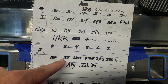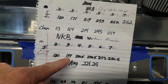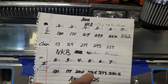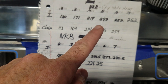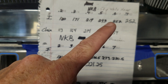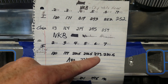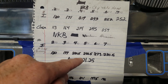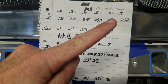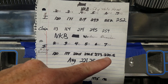Already down here on the intake side at 300 thousandths we're already better than a stock head. A P-head would be a little better, but we're right up in that range, and at 400 we're spanking it. At 500 thousandths we were at 243, now we're at 256 — that's 13 CFM better right there. At 600 thousandths we were at 252 where it topped out before; now we're at 273, which is kind of what I expected — picking up quite a bit of CFM from 500 on up. At 700 thousandths we were at 252 out of the box, now we're at 280.5 — that's 28.5 CFM better.